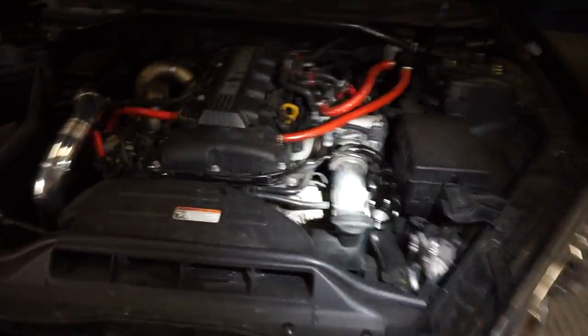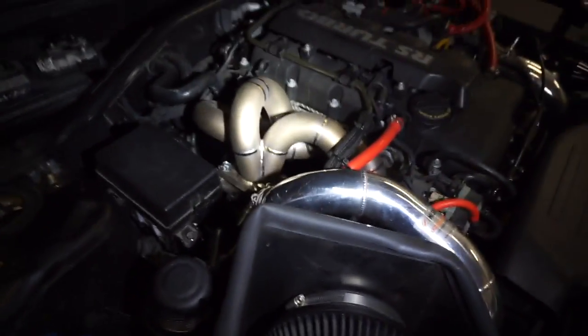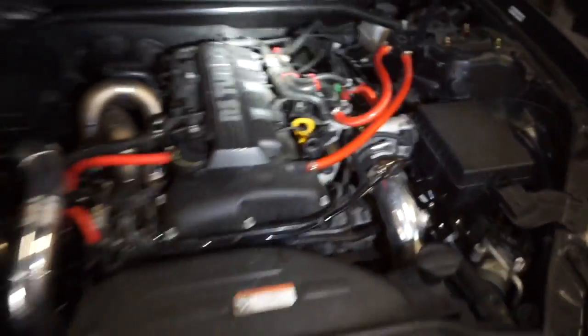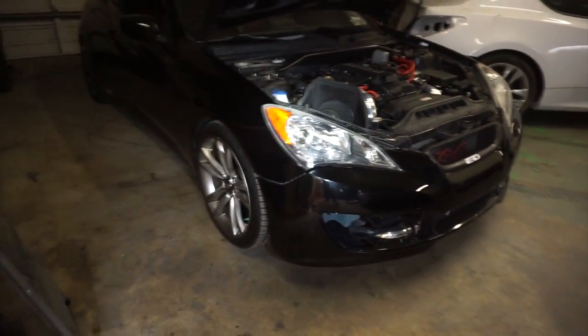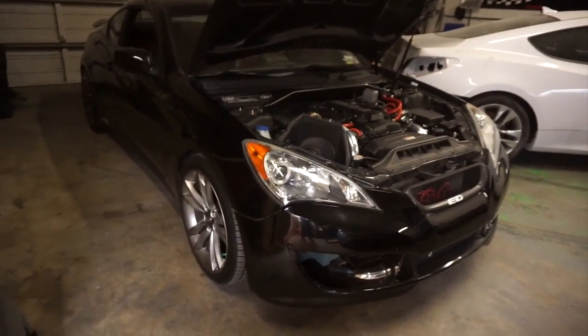Just to recap what I did: I transferred the blow-off valve using that flange, cut and cleaned it up, and got the Synapse blow-off valve installed. The ESR Evo 8/9 kit installed, O2 housing, 750 DW injectors installed, custom tuned, and wideband installed. I'm pretty happy with how it came out and hopefully the customer goes for the test drive tomorrow and feels all the power gained from this install and custom tune. Thanks for watching and I'll see you on the next one.